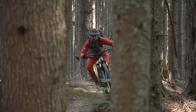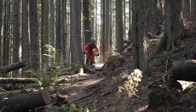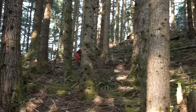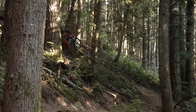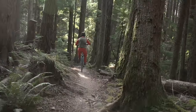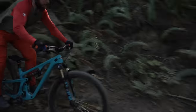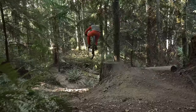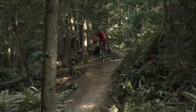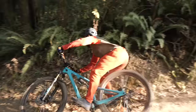When this bike arrived, we were still in late summer with fast, very dry and very dusty conditions. It's worth mentioning that a lot of newer Fox suspension needs some time to properly break in. The combination of still brand new suspension and the harsher 32-spoke wheels meant I'll admit I didn't quite feel like everything was meshing as well as I'd been hoping. I was trying out a set of 2.6-size Schwalbe tires, and on the first ride they felt pretty good. On the second ride, I hit a root and tore the bead of the rear tire. So I gave up that 2.6 idea and went back to the same 24-spoke wheelset I loved on the SB130, along with the same Double Down spec Maxxis tires. I do have a bit more trust in the Maxxis Double Down or WTB Tough casings than any other tire option at the moment.